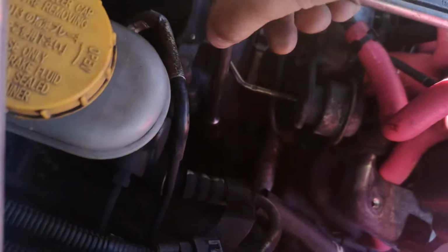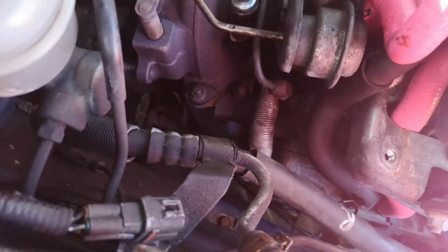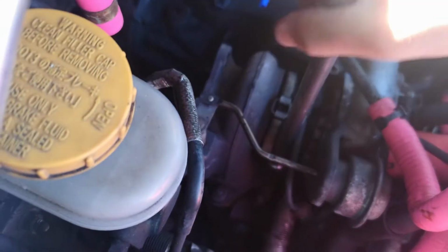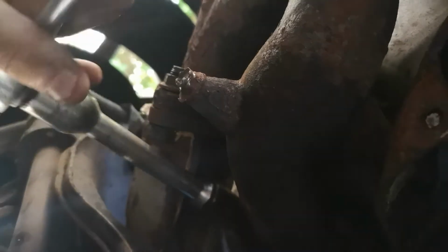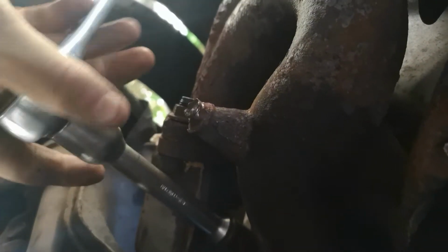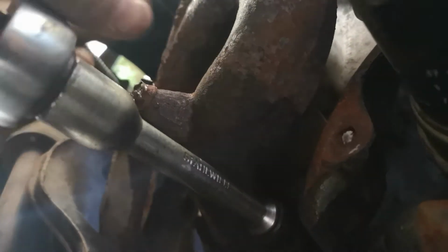That was surprisingly easy. They've all cracked off. As you can see, they're all very loose. So I'll take all these off, and then I'll see if that is them all, and I can drop the manifold in one, and then we'll have a look and see if we can get ours on. So all the bolts are out of the up pipe to the turbo, so the turbo is completely unbolted. There's actually nothing holding the turbo in apart from this manifold and a few lines, so I've just got to be careful when I do take this off that it doesn't snap any of the oil feeds or anything to the turbo. I've just got these bolts to wind off, and that's the manifold off and the up pipe, and then we'll go into removing the turbo.